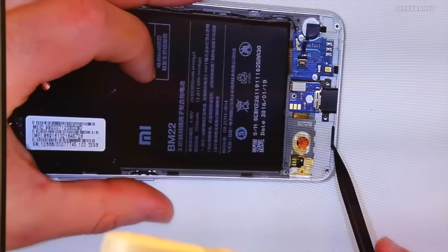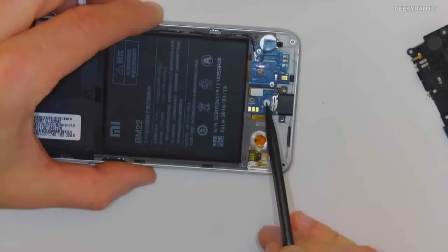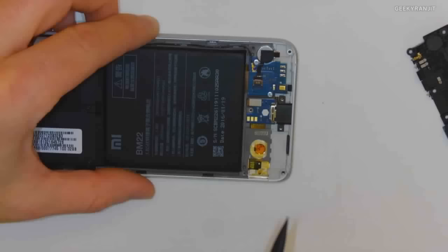One of the things that we do, of course, when we're servicing a device is try to figure out the reason why it may have gone defective. So you'll see a couple of these white dots, and these are water detectors. If water comes anywhere near this surface, it changes color. That's how we know that there was water damage, which is pretty important for our after-sales operation.